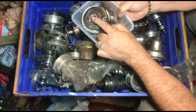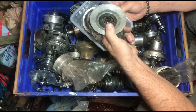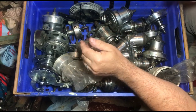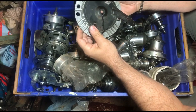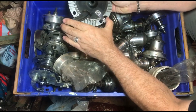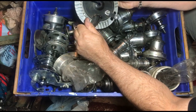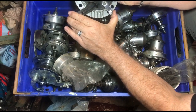Here are some Shimano Nexus assemblies which go onto the dedicated hub with splines - you can use the hub with or without these brakes. Someone's removed them from a Nexus four-speed or something from the 90s. This is an Arai tandem brake - a drag brake. It's not meant to stop the bike; you have it on a friction lever. On my tandem I had a down-tube brake lever with friction set fairly tight so I could pull the lever on and it would just bite the brake.